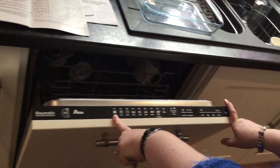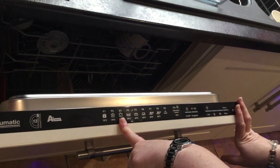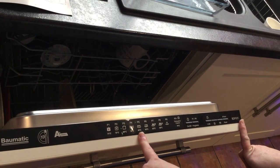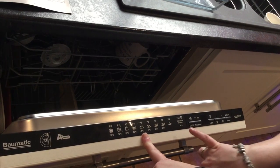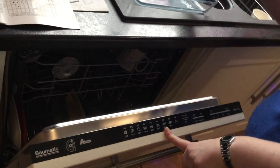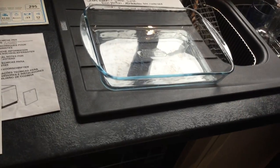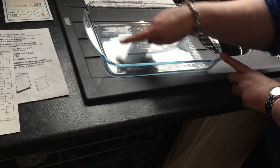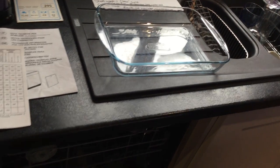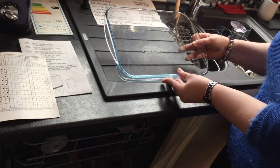The main programme we'll probably use is P3 — the once-a-day soiled pots and pans cycle, good for dried-on food. You can also use P5, which is a very low temperature but quick cycle. The quick cycle, P7, is the 59-minute one. We put a burger pan in on the 59-minute cycle — there was very burnt-on fat and it came out clean but with slight marking still visible where the burgers were. I should have really put it on a P1 or P2 at 75 degrees, but it was a good example to show it's very clean, just not quite perfect.